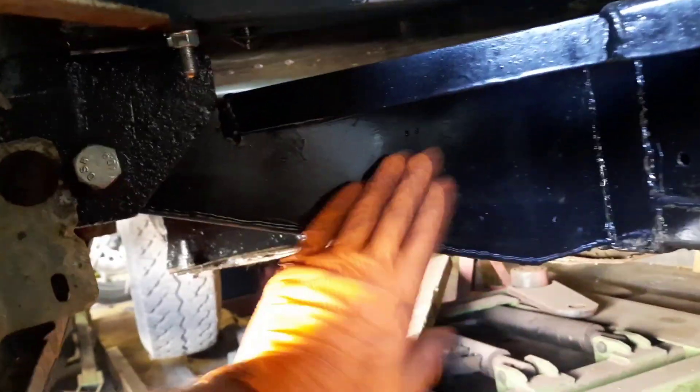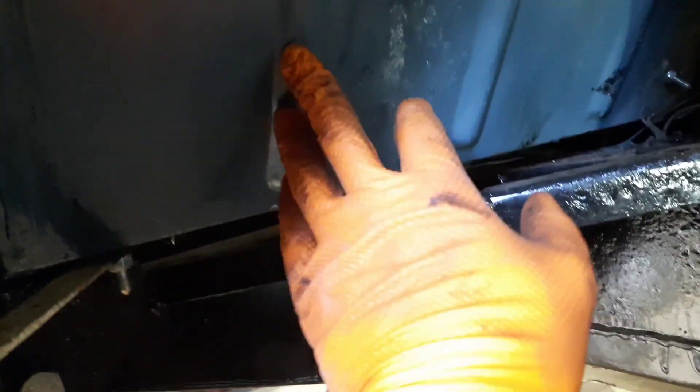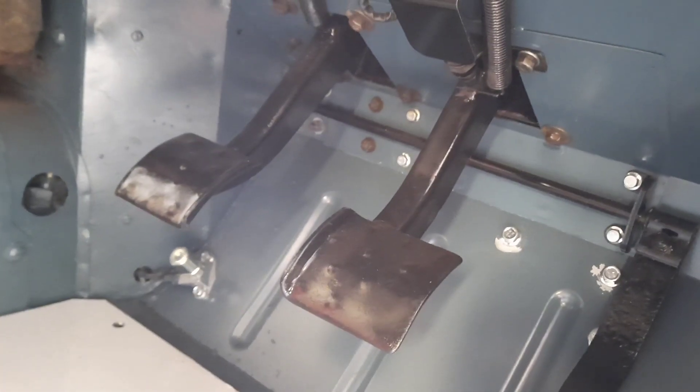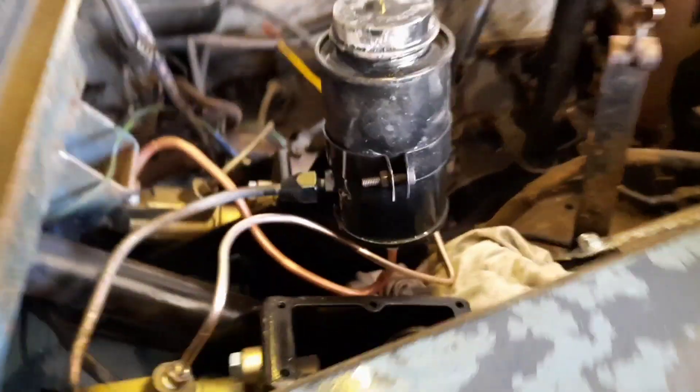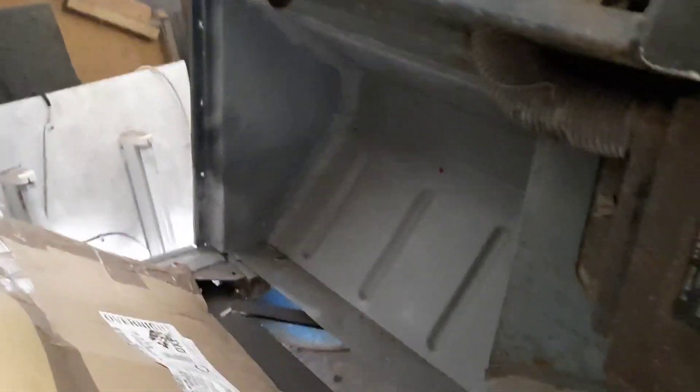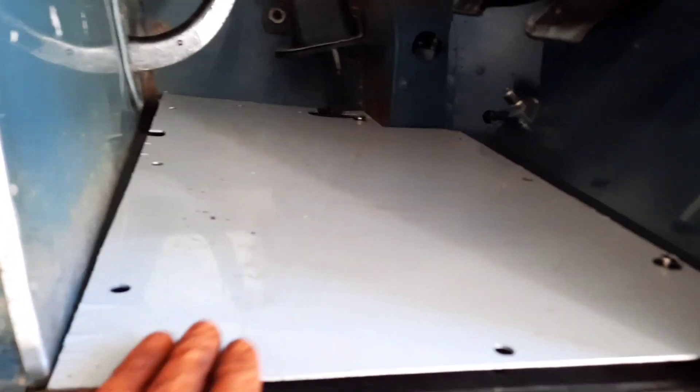So far I've been able to put some new outriggers in these sections here as they were rotted off. I've put new lower bulkhead repairs in just there. I've sandblasted the pedals and painted them up and the pedal boxes. I've started doing the master cylinders and the reservoir and getting the fluid through. Passenger side I've done the bulkhead repairs as well, and the new outrigger on the chassis. I've got new floors for it because they were pretty shot.